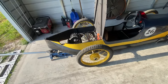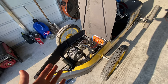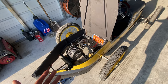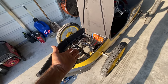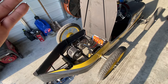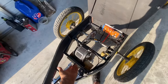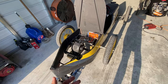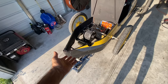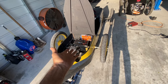Okay, so I got back and I started looking at the data because it didn't really make too much sense to me that I only picked up like 1 mile an hour with that fresh battery. I noticed that it was actually pulling away power as soon as we got to 79 miles an hour. So I started looking around and there was some sort of RPM limit, stopping the RPM at like 7,900, 7,800 RPM. So I lifted that limit up and now it'll spin to 10,000 plus. I just tested it on the jack stand. So that was probably why we weren't going much faster.